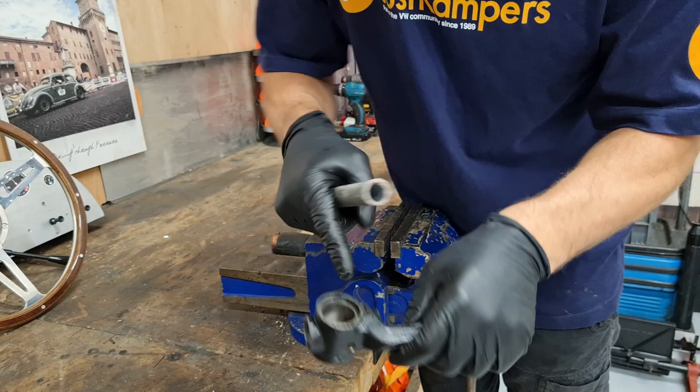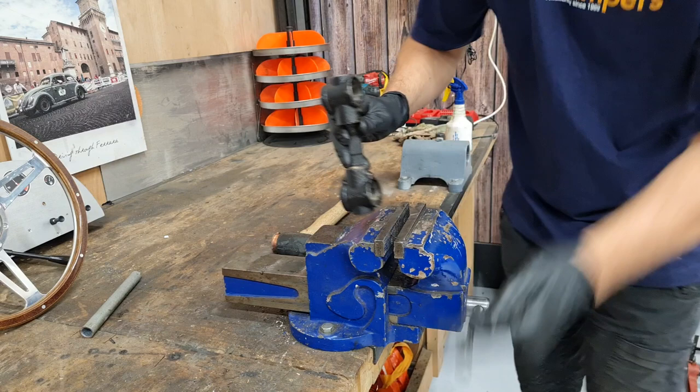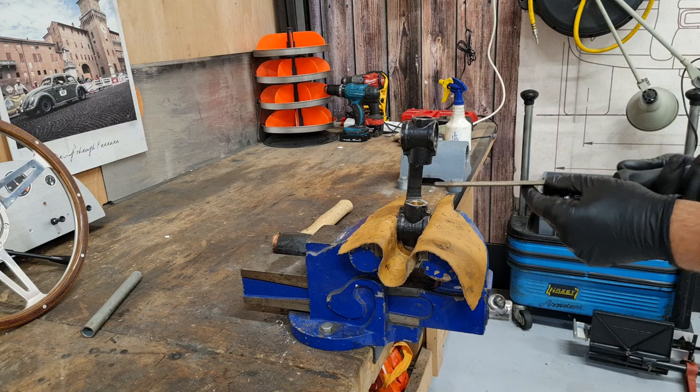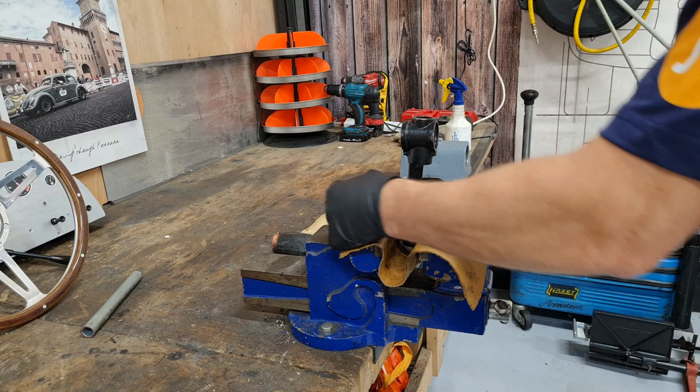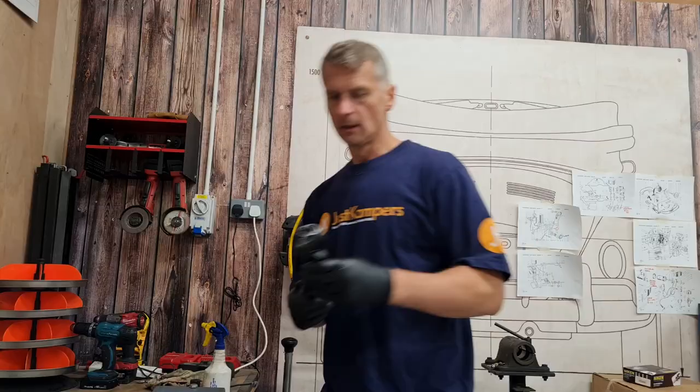The next thing we need to do is file out the grooves. Those grooves hold the cap for our thrust washer assembly. I've clamped it in the vice with a little bit of leather just to protect our faces, and then I'm going to go through with our file and file the grooves for our thrust washer to locate into — taking care only to file the bush and not the link pin arm. Now we've got our lovely groove through there that'll hold the cap in place.